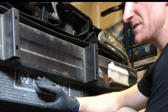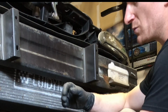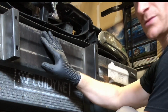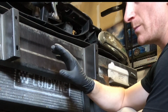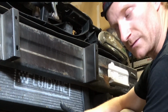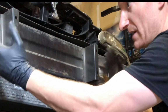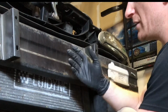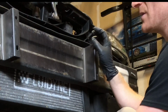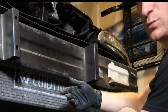And obviously you can see on these 96 Cobras that they have a very small air opening. So what we want to do is try to maximize that. I'm going to replace the entire bumper with a MAF tubular bumper support. They also offer the ability to run a GT500 heat exchanger, which gives us a lot more air area. And it'll help with the 13 to 14 GT500 pump that I also picked up to flow more, to maximize the 0.75 lines before going to 1-inch line.